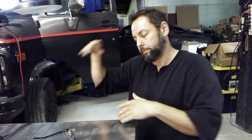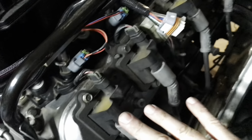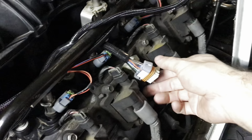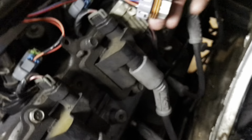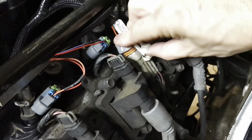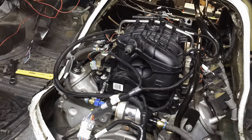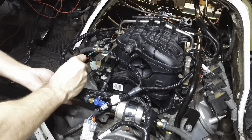The next thing are the ignition coils, and they are labeled even and odd. Two, four, six, eight — that's your even plug — and the odd plug. So everything will fire at the correct time. Here are our ignition coils, and here's our ignition even plug. We plug this in on this side of the engine because these are cylinders two, four, six, eight. There are two ground wires in the harness — we're going to bolt them to the back of the engine heads. Clean, tight connections — those are a biggie. Can't mess around with it. Got to keep it grounded.